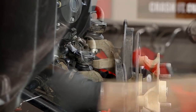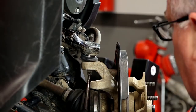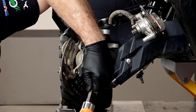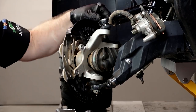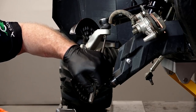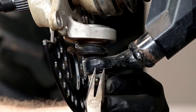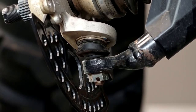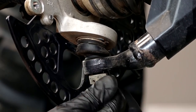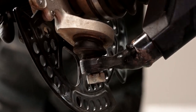With the steering arm out of the way, let's go for that upper ball joint. Let's see if we can knock it out with a punch — I want to be careful doing it this way and not damage the threads. Now let's go ahead and get off that lower ball joint. It's just held in by a 19mm down at the bottom. We're going to go ahead and reverse it, put it back on, then use our hammer to pop it loose. There she goes.